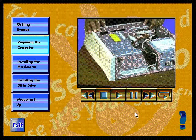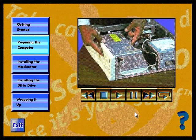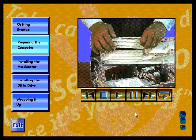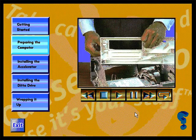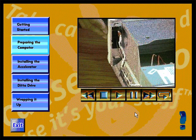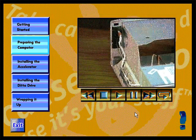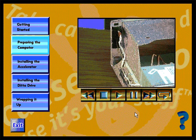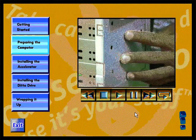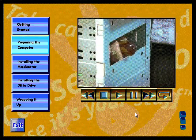Find an empty drive bay. You must remove one of the empty drive bay covers by popping it off — lightly grip the edges and pull gently outward. Then remove the face guard. Typically, the face guard will pop out using your hands or a flathead screwdriver. Get inside the case from behind and gently push out. There may also be a silver metal shield that needs removing; it can be detached by popping it out with a screwdriver.